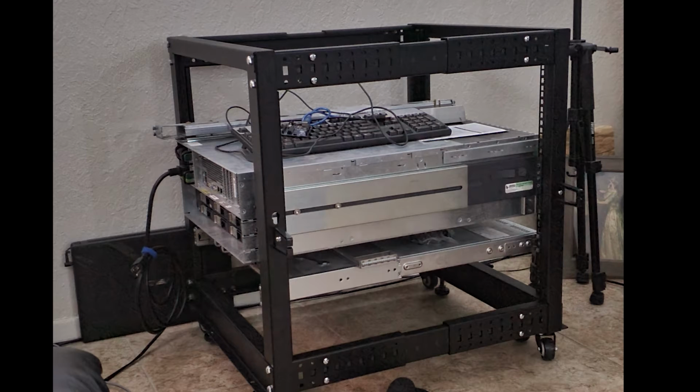I was able to figure it out. Kind of clips in there, so you have to actually extend the slides there past those square holes in the front and the back, and then it pinches forward and backwards in order to get the server mounts to grab onto one, each other, and two, the actual rack itself. And then the server, the actual compute server, just slides right in that, which is really handy.